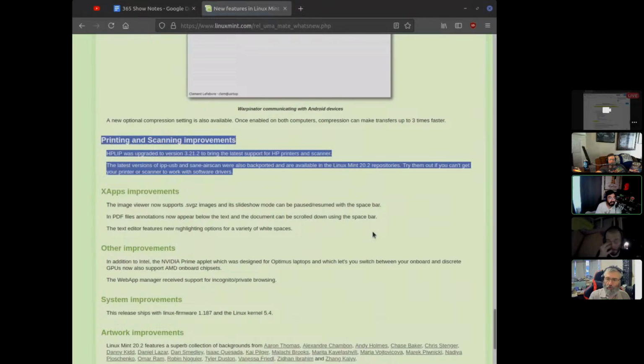How weird. And it's not like you're dealing with PPD files or anything like that to get the driver to work. Nope. It's HPLIP that handles all of it, right? Yeah. How weird is that? Like I say, I can open up a Writer document in LibreOffice, and it actually shows the printer. If I use it on my desktop machine, it shows me the Brother and the HP. You set it to send it to the HP, and nothing happens. You send it to the Brother, it prints perfectly. Yeah, because I've got a Brother printer here, and I've never had any issues with it. It finds the correct driver immediately.